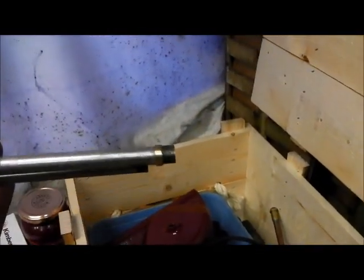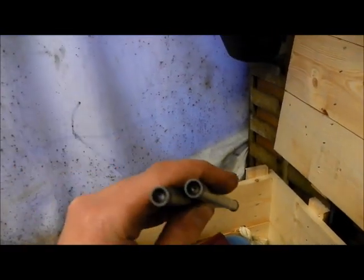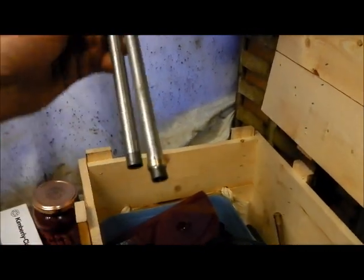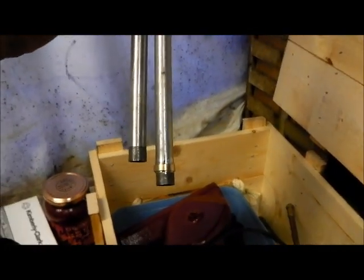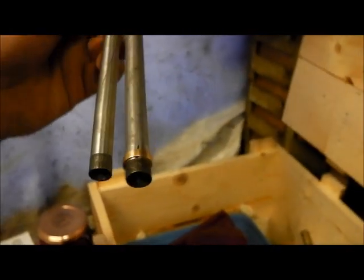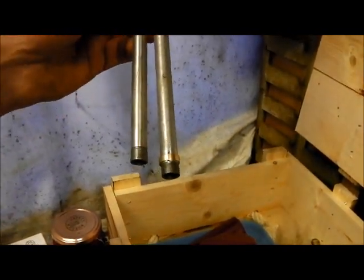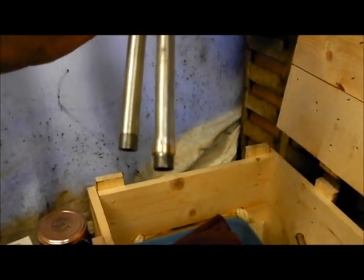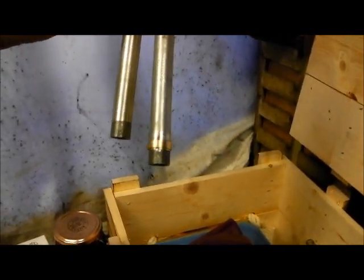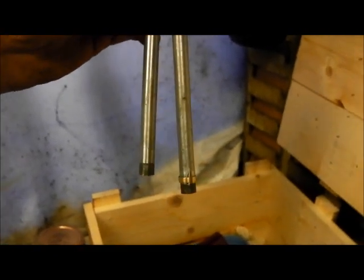One thing I have had to do is repair the pushrods. They've got these hardened steel cups pressed into the end, and that one had split at some time. Someone had araldited it in there quite badly. So what I've done is cleaned it all up and put it in there with some Loctite, and I've pressed a bronze sleeve on there which has pulled it all back into line. So I'm pretty confident it won't give me any issues.